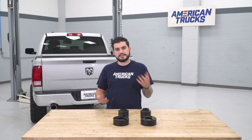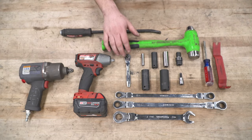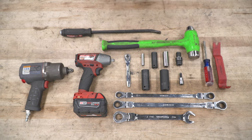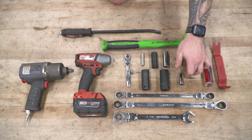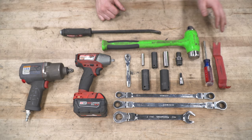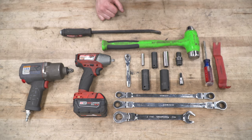I'm gonna walk you through the whole process, so let's get started. Tools used in the install include an air gun and an impact gun, quarter-inch ratchet, 8, 16, 17, 21, and 15-16 deep sockets, 13-millimeter swivel socket is recommended, 8-millimeter hex socket or Allen key, hammer, and a pry bar of various lengths, flathead, handy panel removal tool, 15 and 18-millimeter ratcheting wrenches, and a 21-millimeter wrench.